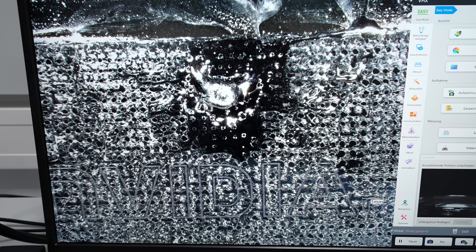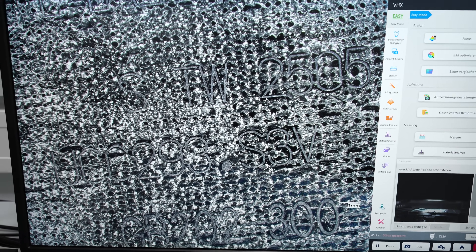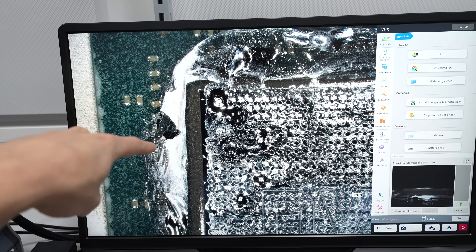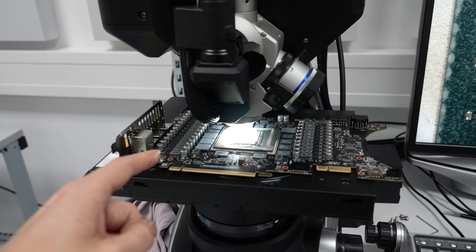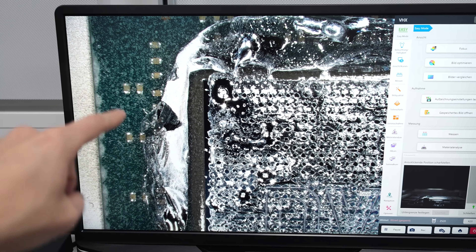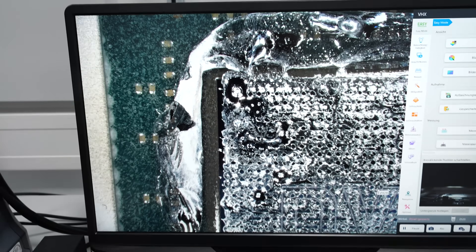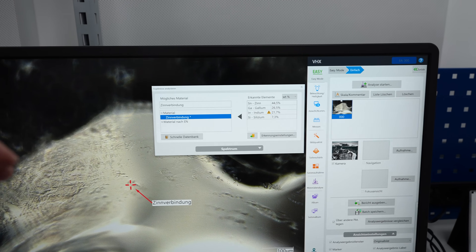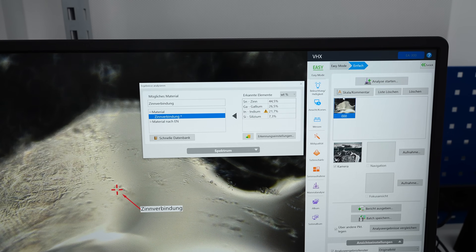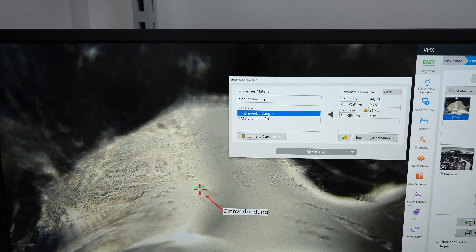You can see some bigger holes as well, but again that could be an artifact of disassembly. This pattern in combination with a liquid metal application is something I have not seen before. I absolutely have to investigate this corner — the top left — which looked a bit odd in the previous video. I need to clean it first to check if the protective glue covering the capacitors is missing or partially peeled off. The composition analysis shows a classic gallium, indium, and tin alloy — just a classic base type of liquid metal. The exact values shown aren't correct so don't pay attention to them, but we know tin is present.